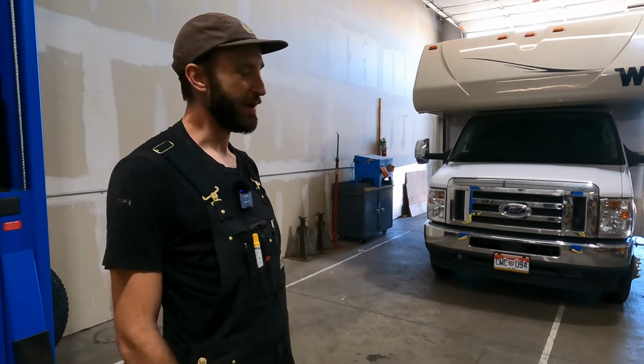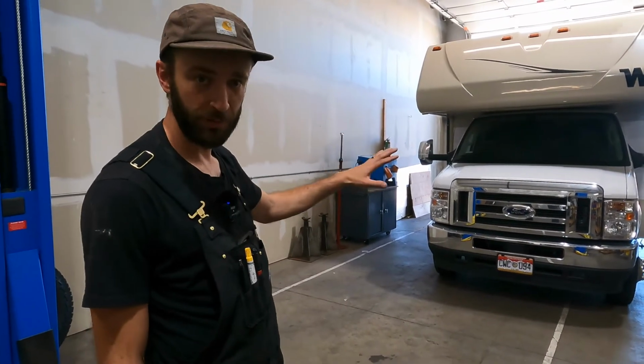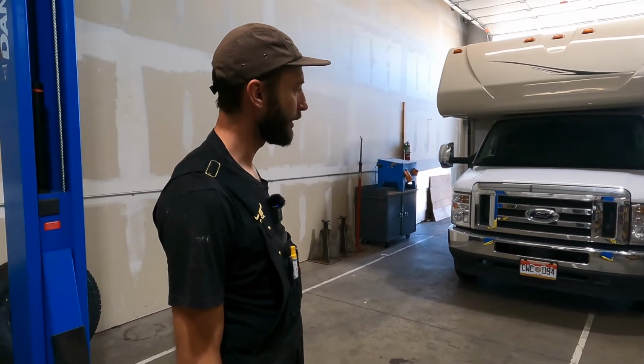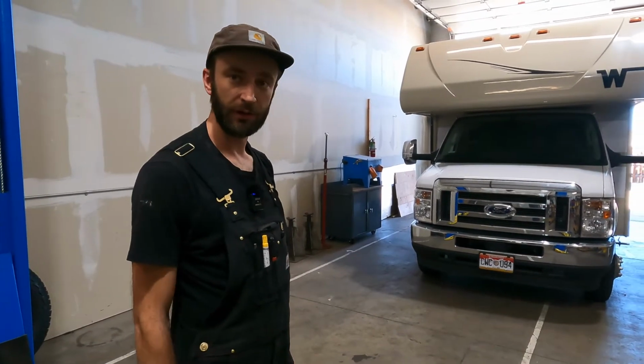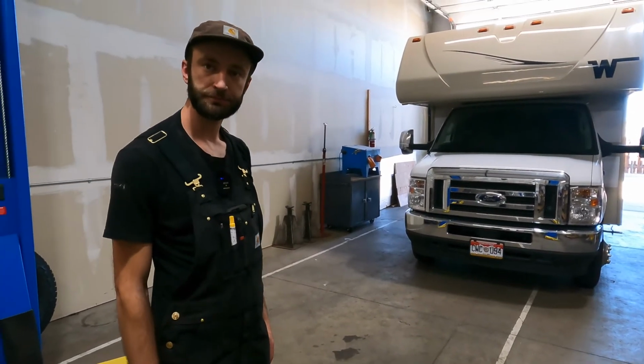So really all we do in the back end of this vehicle is we're going to put our lift springs on the back of it, our heavy duty leaf springs. And then we're going to put in the Fox shock absorbers. We're going to extend some brake lines down, and that's about it for the rear end. Okay. It's pretty simple. Let's talk about those springs, the suspension system.